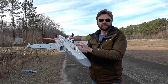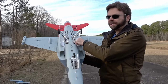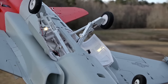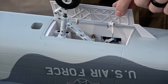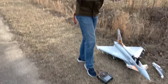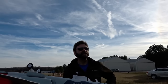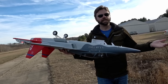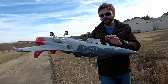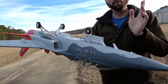If it was powered, I wouldn't be able to do that. Same with these gear doors here too, except they are more stiff because of the design of the linkage. See how they're at almost a 90 degree angle to each other, so they can't move. But this arm right here — see how that can move with just mechanical advantage? Follow me as I go ahead and throw the switch on the gear. The gear is being actuated, closed by air pressure alone. So the nose gear catches on it and then the entire gear hangs up and it doesn't work. I almost guarantee that's the issue — I can't push this door anymore, it's stuck.